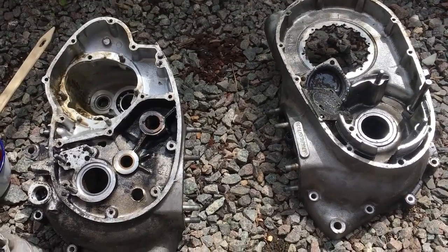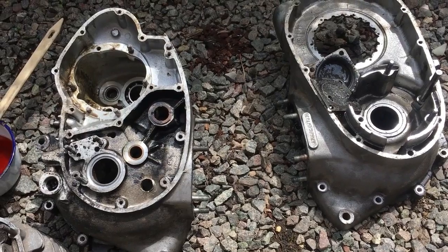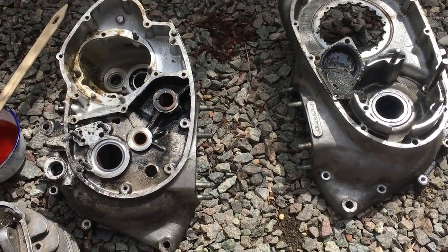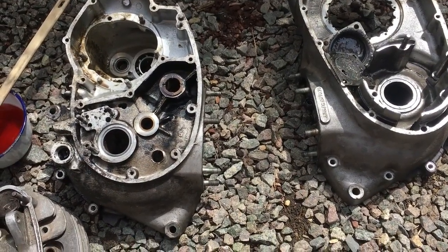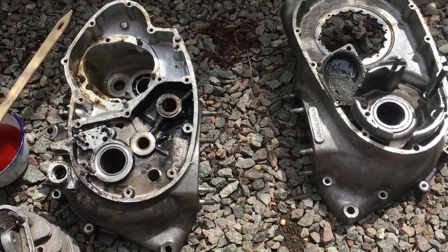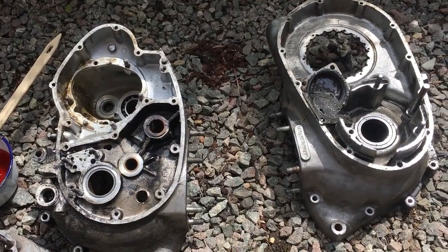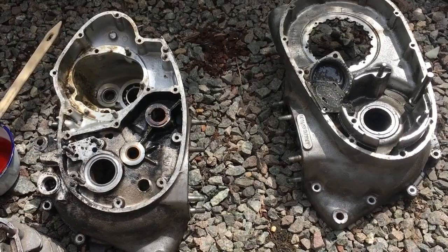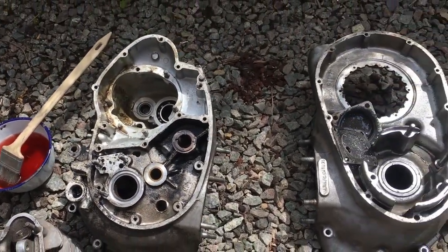You can imagine how that stuff has got into the sludge trap in the centre of the crank and probably completely blocked it. I've known A65s being rebuilt — or ones that have let the left hand rod go — where the sludge trap in the centre of the journals in the crank has been absolutely jammed solid with residue, to the extent where you can't wash it out. You've got to drill it out, or alternatively take the sludge trap out and replace it, because it just gets packed down so tight with the revolutions creating centrifugal force. You can imagine why this engine let go.